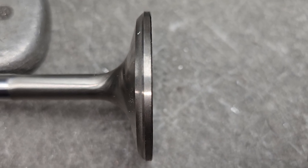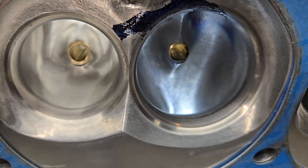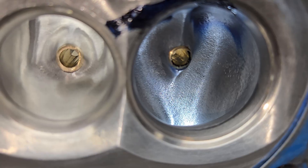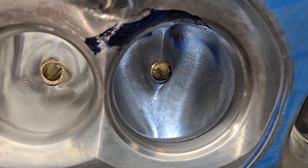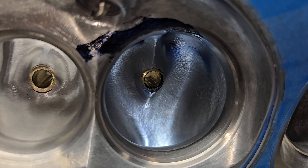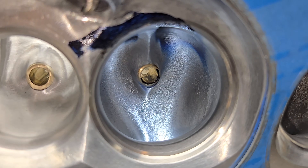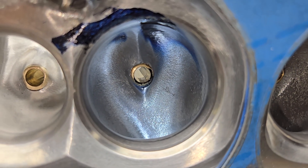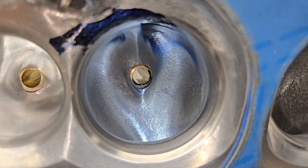The owner said that's a good idea and we're getting an extra exhaust valve just to test with. We are also getting extra intake valves. This was tested exactly the same as it was tested last time - without a back cut - because I wanted to see if the CSA made a difference. I figured it would change the swirl considerably because the entire port is shaped a little bit differently now. That could be a problem if you have something as nice as a TFS 270 and you go in and make changes - you can cause some problems.